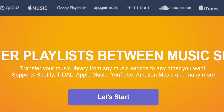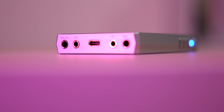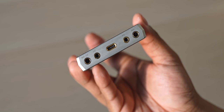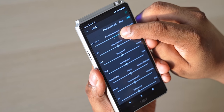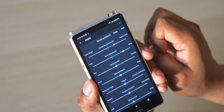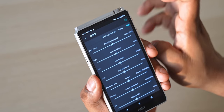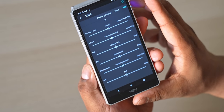Coming to raw audio specs — for those interested, we've got dual Sabre chips here, the ES9038Q2M. You get dedicated outputs for line outs and headphone outs, and there are also balanced and single-ended options for both. A balanced line out dedicated output isn't something you generally see, but it's here. I love the MSEB tuning available here — it's not something I've come across a lot. It's global control that lets you adjust how your audio sounds, with a pretty granular interface that's quite noob-friendly compared to a regular equalizer. The changes you make are global, meaning it affects pretty much any audio output regardless of whether you're using the HiBy app, Spotify, Tidal, YouTube Music, or whatever.